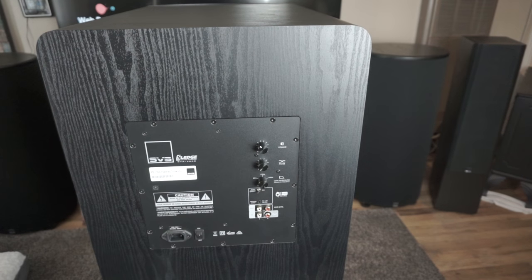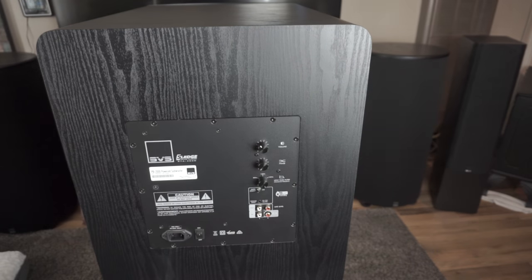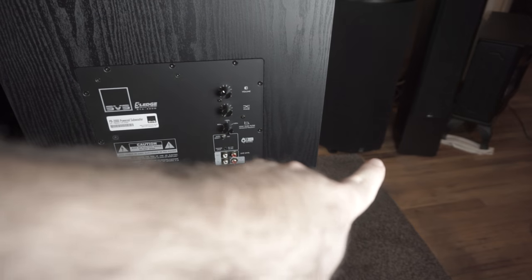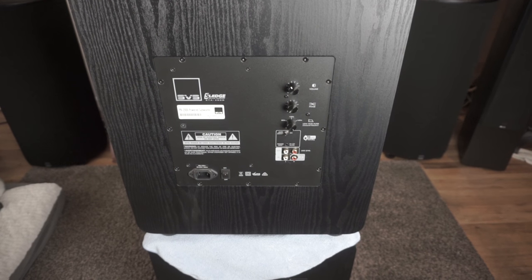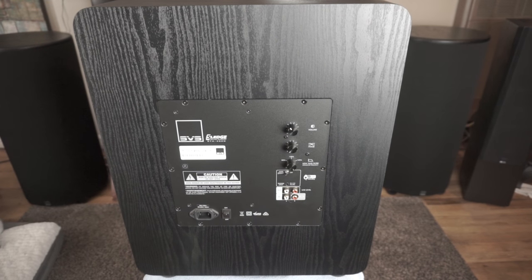There's going to be some contention here, but what I've found personally is that the down-firing sub — you'll notice I have wood floors — tends to cause a little more rattling. Both of these subs have isolation feet on them, those little rubber feet that reduce some of the transference into the floor. That's another great idea: some sort of isolation system. SVS makes a good one, there's also the Sub Dude. Anything you can do to reduce transference into your floor is worthwhile.